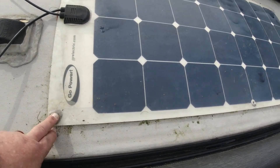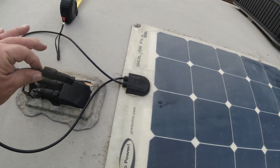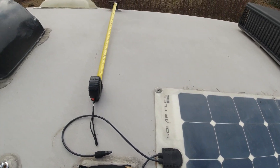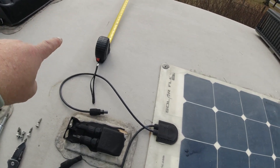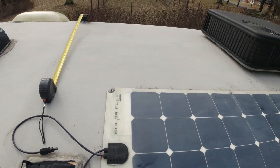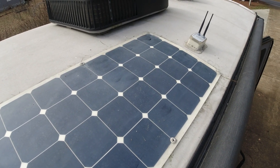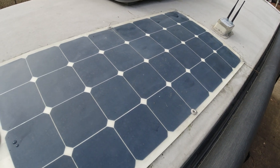I've come to the conclusion that, as much as I don't want to, I'm going to leave the old panel as is. I've only pried the edges a little bit, so I'll go ahead and put new sealant on these six screws and put it back. At some point I'll terminate those wires so there's no current flowing. The only problem now is my new solar panel will have to go up dead center of the camper — my wires may not reach the connector, so I may need an extension. I'm just too worried about tearing that roof membrane.